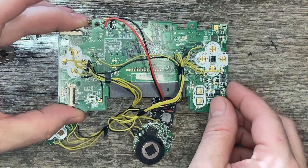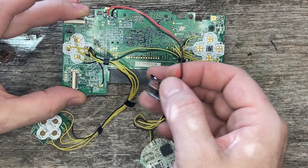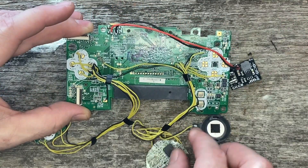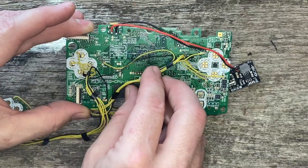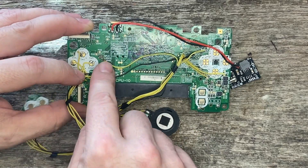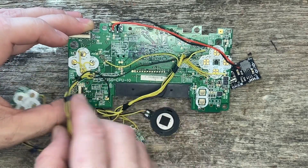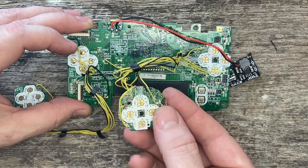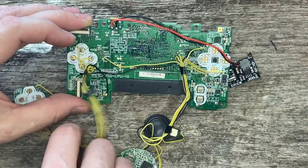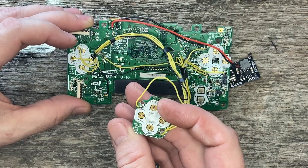Here's the motherboard and how I soldered up the buttons. The button PCBs on the front of the unit are actually from a hacked up DS Lite. It has a Type-C module. You can see how I ran the wires here — basically those wires are jumpered directly from the buttons to the button PCBs that are from the hacked up DS Lite board. You can see I just cut it with a grinder literally. This is all from a dead board.